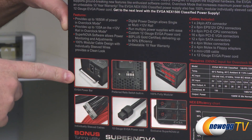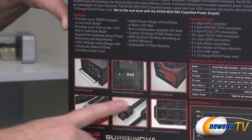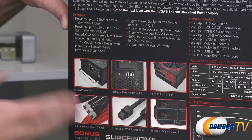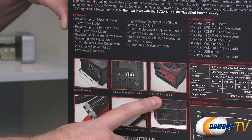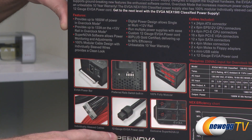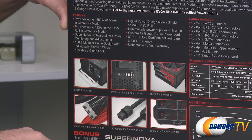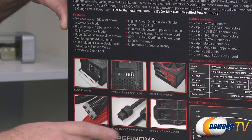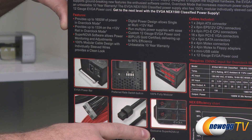Other features shown on the box include a power bar handle — nice and sturdy. You get some dip switches on the back of the power supply; you can flip those on and off to do things like switching between single rail and multi-rail mode. It's fully modular with individually sleeved cables that look really nice. You get a 12-gauge EVGA power cord — very heavy duty — with a special plug to make sure you don't accidentally try to plug in one of the lower-gauge cables that come with a much lower wattage power supply.